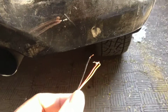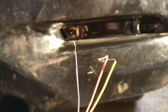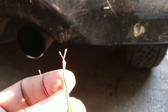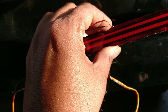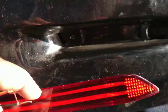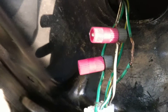This LED light set has three wires: one goes to negative, which I'm going to tap from the wire above; the red wire is used for the brake; and the yellow is for the tail light. When the tail light is on, this LED lights up, and when I brake, the other wire gets power from the brake light and gets brighter. I'm redoing the connections using the Posi-Tap for a stable and secure connection.